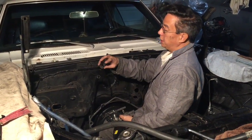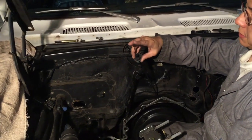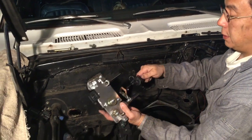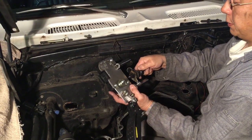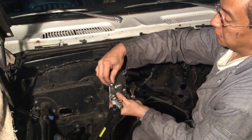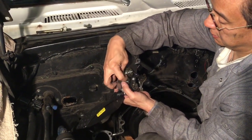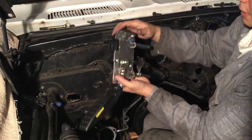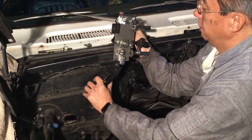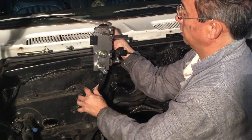This is my TV cable. I don't know if TV cables come in different lengths, but mine sticks out about seven centimeters. This is how it mounts in here once it goes through the firewall — it'll come through here and click in place, and the TV cable will wind around and go in here. When you press on the pedal, it'll pull the cable.